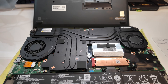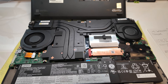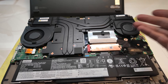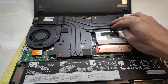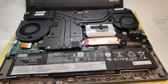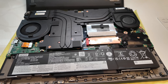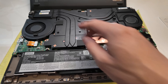Here's a look at the internal cooling system on the laptop — an RTX 4090 and 13950HX. Very hot CPU, very hot GPU. It has pretty good cooling: two fans, heat pipes with a vapor chamber. So overall it's a very well-cooled system. It doesn't run at full wattage though — the GPU is not going to be like a 170-watt variant. But again, it's still hot components.